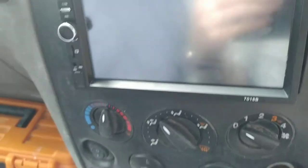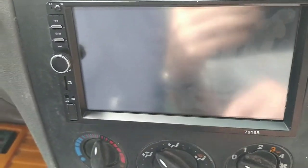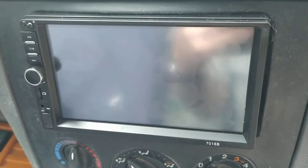This is a Ford Transit Connect, March 2006. It has a 1.5 DIN, or one-and-a-half size, stereo slot which is a bit of a pain. But if you cut the plastic off the bottom, there's a lip at the top and bottom where the old stereo clipped in. This is a snug fit — I just cut it off with a Stanley knife, a bit of sandpaper, and pushed it straight in.